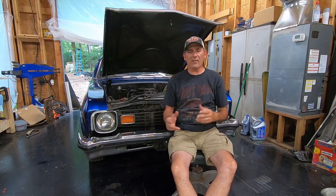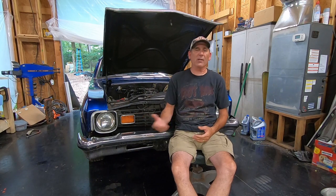What I'm going to do now is leave it like it is, drive it around some, then reload the learn table onto the base tune to get it more accustomed to Georgia weather instead of Kansas weather. Then I'm going to take it to the track this Friday night if it doesn't rain like it did last Friday, run it in the same combination, and hopefully get most of that lean stumble out. That way I'll know the difference between Georgia and Kansas conditions.